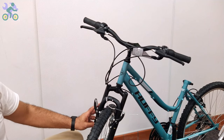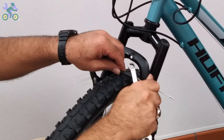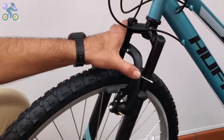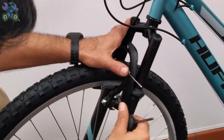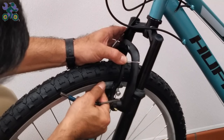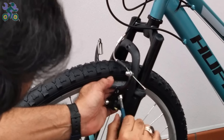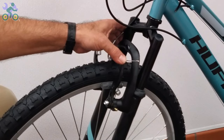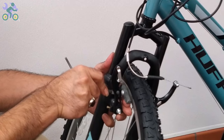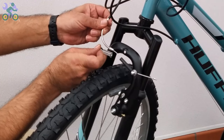If the brake wire is not already loosened, loosen the anchor nut holding the brake wire. Check that the brake pads are only in contact with the rim when braking. Press the brake arm and observe the position of the pads and adjust them if necessary. To tighten the brake pads, use your thumbs to hold the pads in place as you are tightening them — this prevents the pad from rotating during tightening. Put the brake knob or brake noodle back in place.